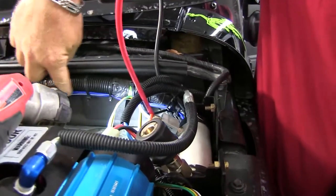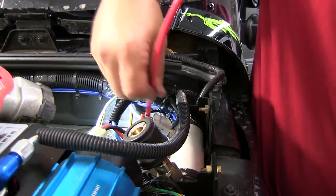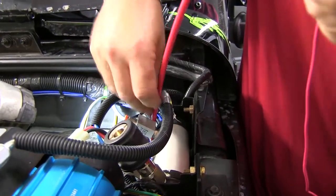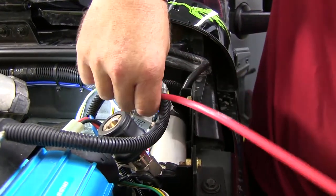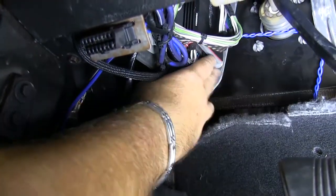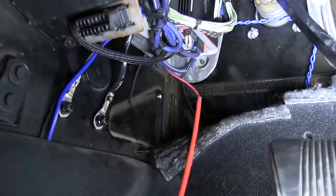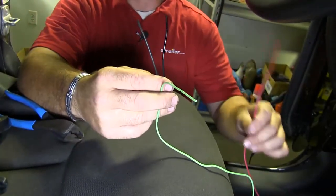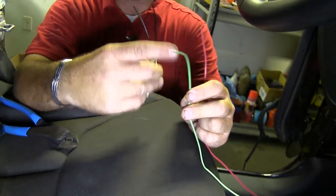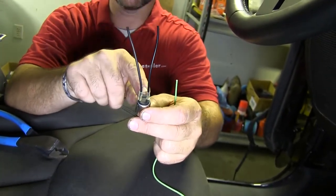This individual has some extra stuff and these blue wires I found run through that grommet. So I just followed and pushed my wire through that grommet. Now we'll go inside the vehicle and see if we can see it on the floorboard. You can see this is where the wire came out, right behind this large bracket that has all the factory wiring on it. So I'm just going to pull this until I get my wire. Now you're going to have a green wire and then your power wire that we just ran through. The power wire is going to go to the positive side of the battery. The green wire is going to go to your braking system that's going to be inside here.